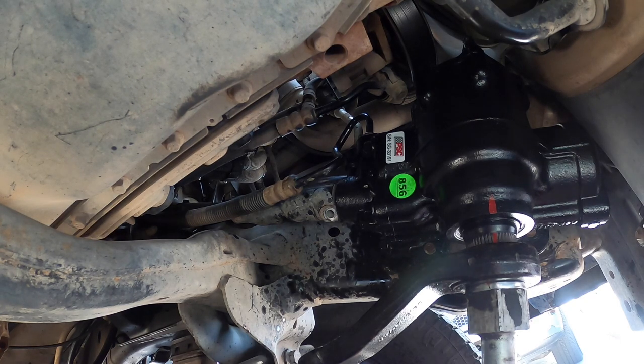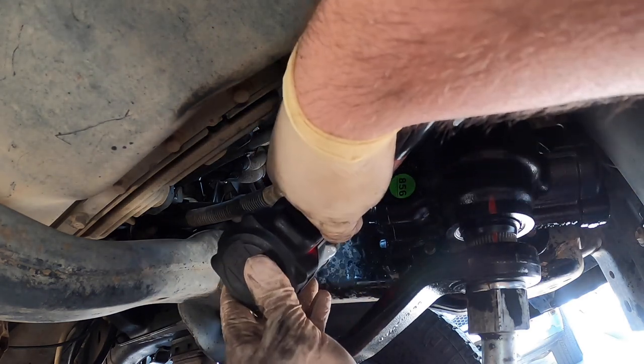You want to make sure that that steering wheel doesn't move. So I have it tied up with the seatbelt. I'll show you guys that when I get out. But you want to be sure that steering wheel does not move. If that steering wheel moves, and you lose clock of it, then you could damage the clock spring. And some of these clock springs nowadays are very expensive.